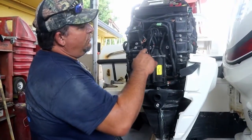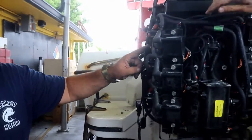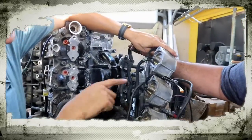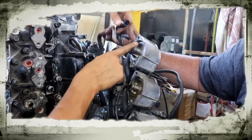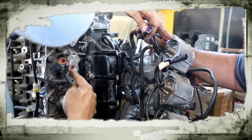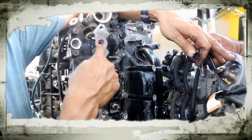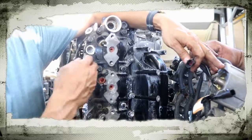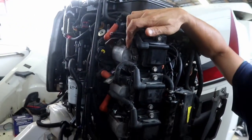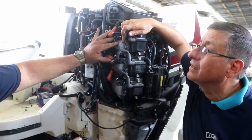So once it pressurizes, it goes through a fuel rail, which is a hose, which is different than the Optimax, which actually feeds into each individual injector. These are the injectors right here. Injectors are similar to the previous one, or no? They're different. The previous one worked off a 5 volt reference. This is actually a 55 volt circuit. 55 DC. Yeah, they call it the SAC circuit, which is the 55 volt circuit.